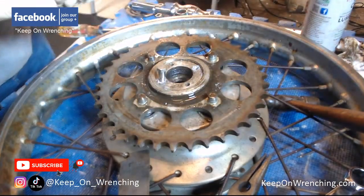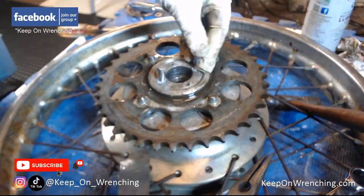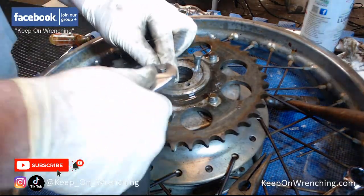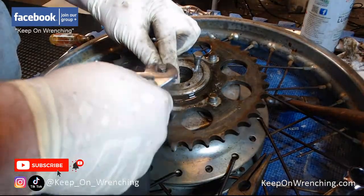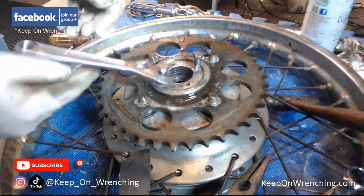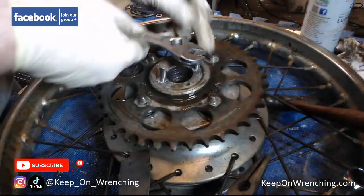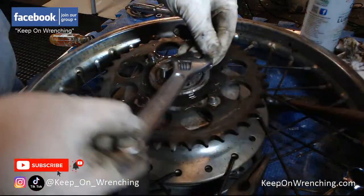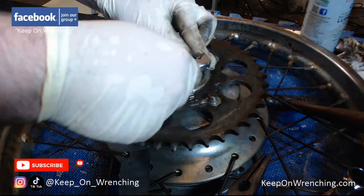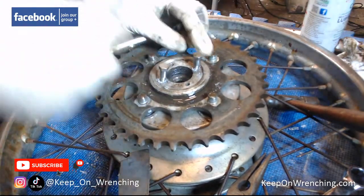Yep, that's going to work. Get this one to go in. Just like that. Oh, where's my adjustable wrench? I'm sure it's a 10 millimeter, but whatever. There. Get this to go in. So basically, this will be our little lever that we can use to turn this thing out of here. Just like this. And before I did this, I made sure that these bolts match that tap, so I know I have the right tap for the right bolts. I think that should be good enough. Don't want to go too deep.